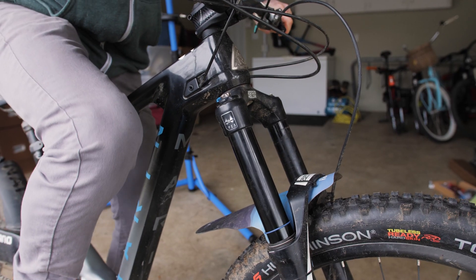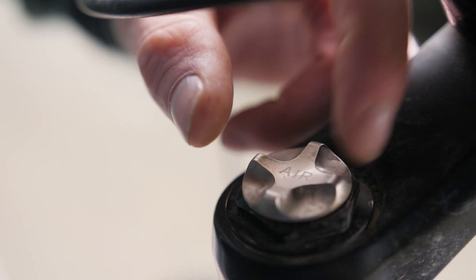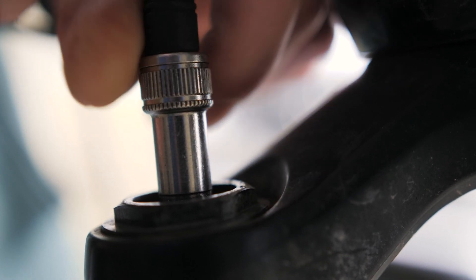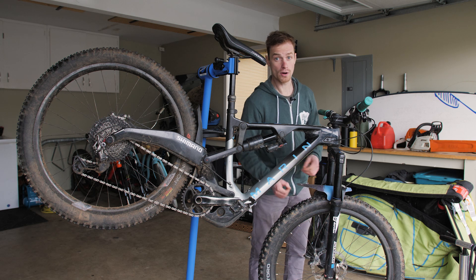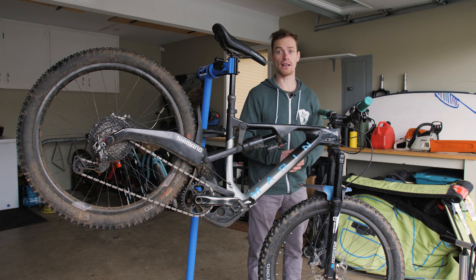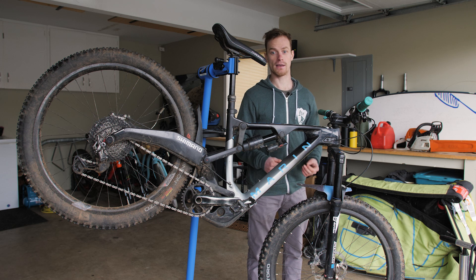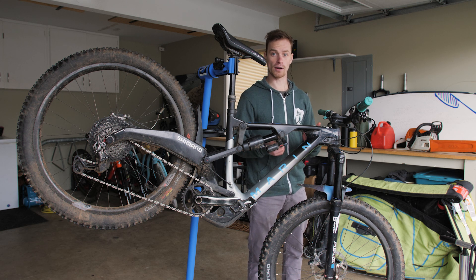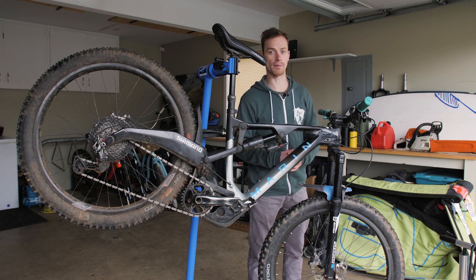Next, let's look at suspension. Whether you're on a hardtail, you'll probably have a suspension fork up front. The number one thing you can do to change its feel is adjusting stiffness. Most forks are air these days — undo the top cap, pump it up with a shock pump. The back of the fork has a user manual showing recommended air pressure based on your weight. I usually go 20 to 30 PSI above the recommendation because I like a stiffer fork for bigger jumps and aggressive steep ramps.